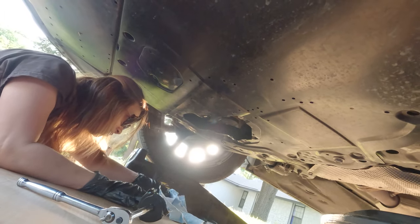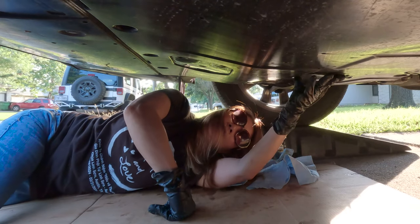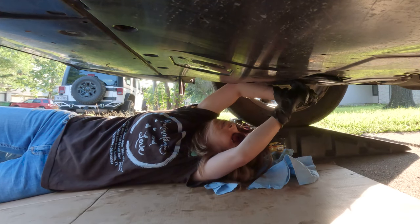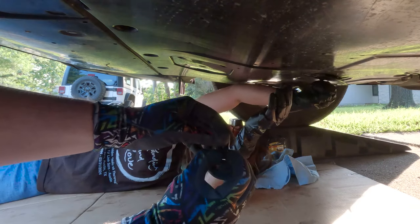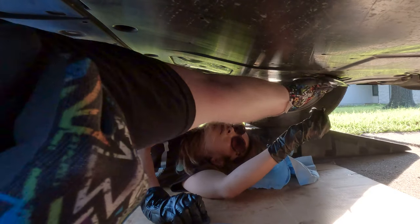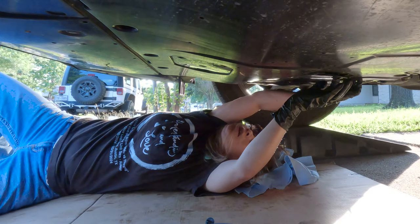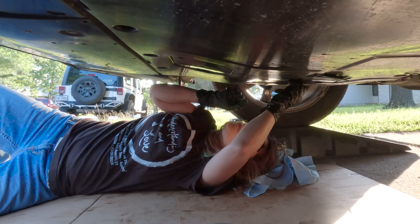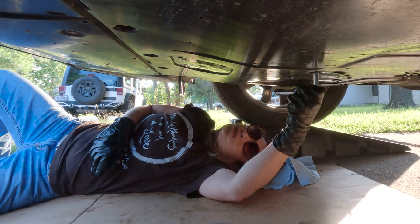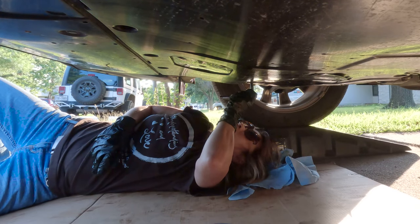Go ahead and put your little plastic cover back on. It kind of had some tabs that it sort of slid up in there — the front side kind of dips in first. For the plastic push pins, you've got to have the middle part out. With that middle part pulled down, put it in and push from the bottom flange, then push the middle part in. It's a little mangled — obviously whoever did your last oil change wasn't too gentle with it, but it works. Those things aren't going to get super tight because they're just going into plastic — you don't want to over-tighten them. Just run them up until they look flush.